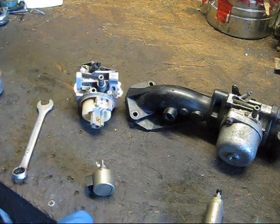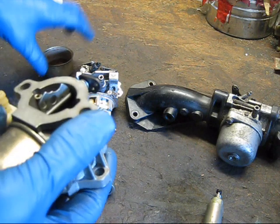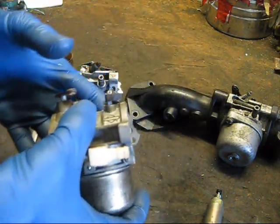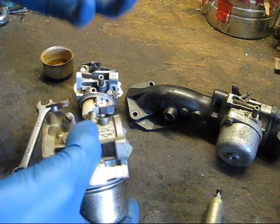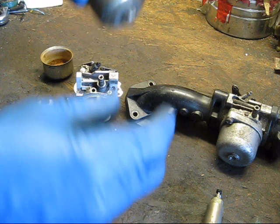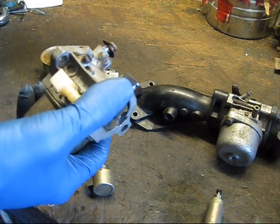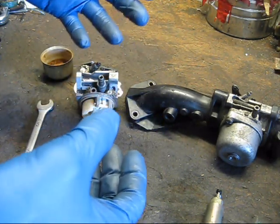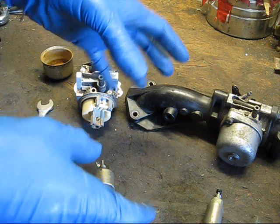Now some might ask why the older engines didn't have backfire solenoids — a question that comes up a lot when people talk about deleting these solenoids. There's a very simple explanation. What I have here is a run-of-the-mill Walbro LMT carburetor, an older style typically used on the Briggs & Stratton flathead. Just about every engine with overhead valves tends to have a backfire solenoid. The reason is simple: in the old flatheads, they simply weren't that efficient. They were very durable but not very efficient, so while they would draw fuel while coasting down, they didn't tend to push it into the exhaust causing a backfire. But when they went to overhead valve engines, which were more efficient, they suddenly had the problem of the engine pumping fuel and air through into the exhaust, creating the backfire. So this was a very simple solution to that problem.